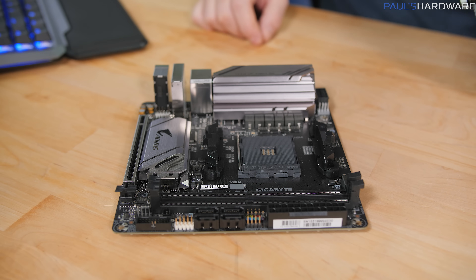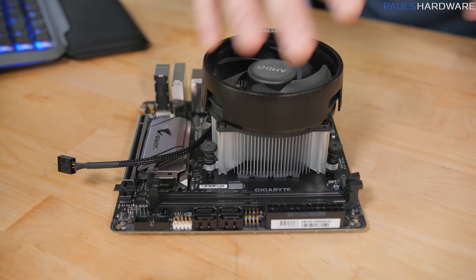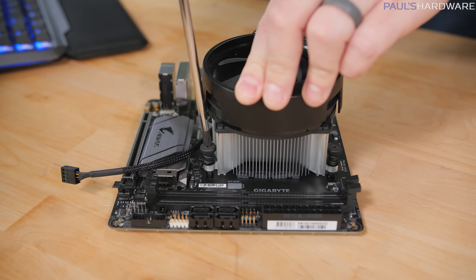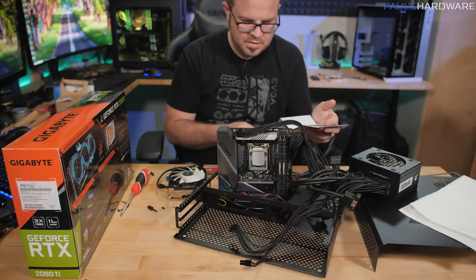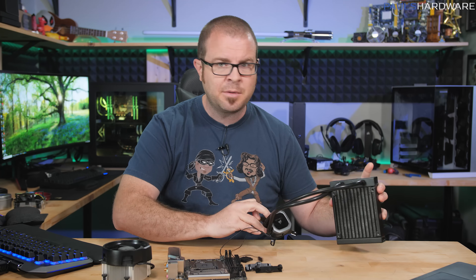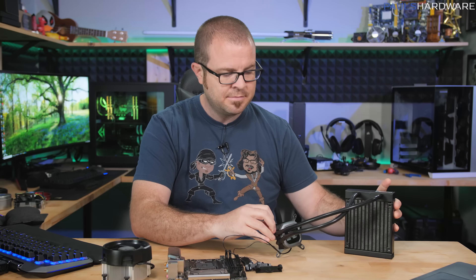AMD's CPU cooler mount would come in second in this race, but stock AM4 coolers actually require the removal of two brackets in order to install it properly, which slows things down and then you have to secure it with a screwdriver. The biggest time suck beyond RGB lighting though is aftermarket coolers in general, with their specialized backplates that you need to install, and often confusing installation procedures that vary from cooler to cooler. AIOs would definitely come in last, because after you mount the CPU block to the motherboard, you've also got to mount the radiator and the fans to the case — just a big waste of time.